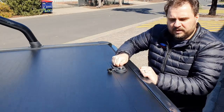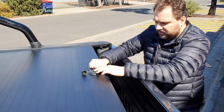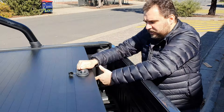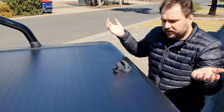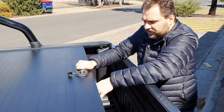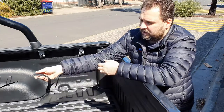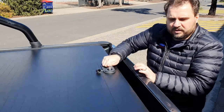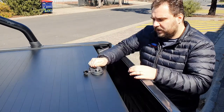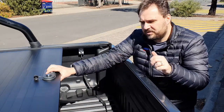If you leave it in neutral it won't close — it looks like something's malfunctioning but it's not. It means the locking mechanism isn't engaged. You either have to let it go all the way back so it engages the lock, or pull the strap to the left so it locks. Pull it back, press the button — in neutral it won't close. Pull it to the left and it locks, or let it go all the way back and it engages at the end. If it's not staying closed, that means you haven't engaged the lock after opening it.